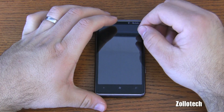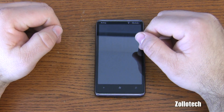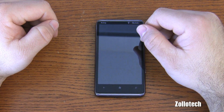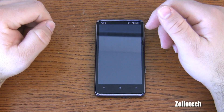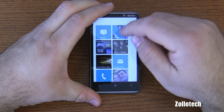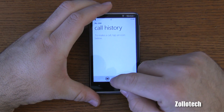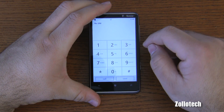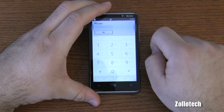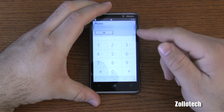You can unlock this free of charge from T-Mobile if you have a T-Mobile account and you purchased the phone outright — like I did, I bought it on Craigslist. You can also buy it on eBay or anywhere else. What you do is turn it on, go to the dialer, and dial *#06# — this will retrieve your IMEI number on any GSM phone.